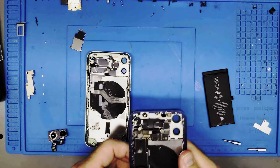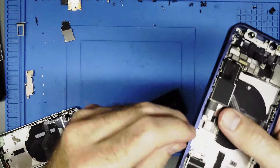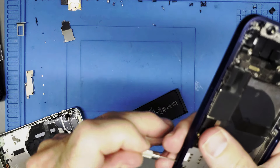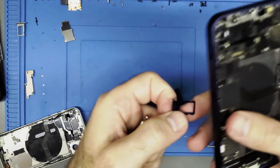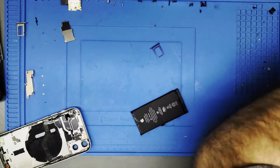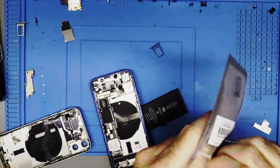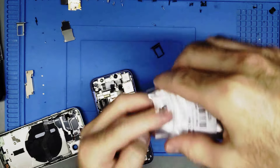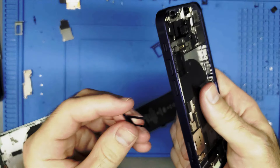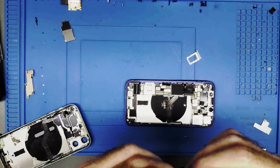Good — the back camera is in. Now the sim tray that came with the housing isn't sitting right inside the phone — I think the gasket is too loose. That gasket is definitely loose, so the phone may have come with a sim tray but it's not cutting it for me. Fortunately I have the one I purchased separately — it'd be frustrating to have to wait another day just for a sim tray.